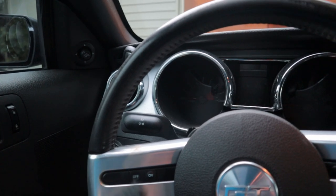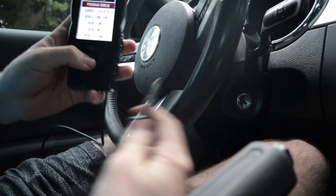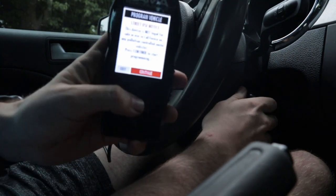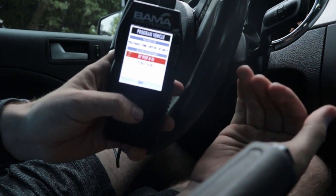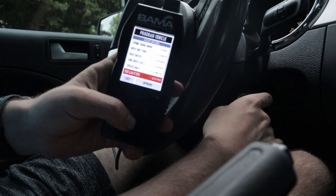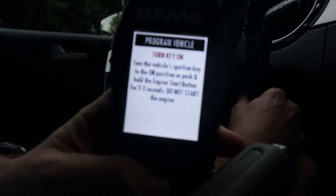Now in the car, I'll plug the tuner into the OBD port under the dash using the included cord, then plug into the top of the device. The screen comes on — click 'program vehicle,' and it will warn you it's illegal in California. Turn the key on, press continue, it processes some data. I select the 87 performance tune since that's what's in the tank right now. It shows you the parameters, click 'approve,' press continue, then it tells you to turn the key off and back on.